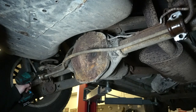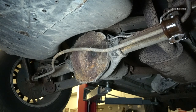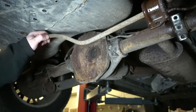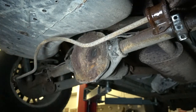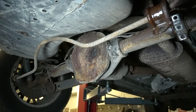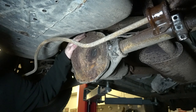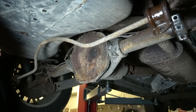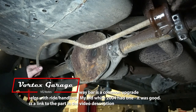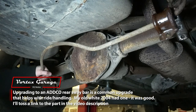That side's much better. Now that you've got your sway bar out of the way, you've got a lot more access here. The top bolts we won't be able to get our impact on. We can try ratchets, or a right angle impact would be really nice. Now would also be a good time to upgrade your sway bar — that's a pretty common WJ upgrade, putting a thicker sway bar on.